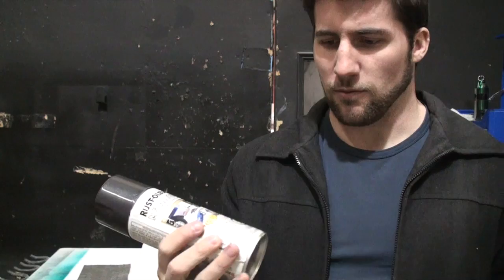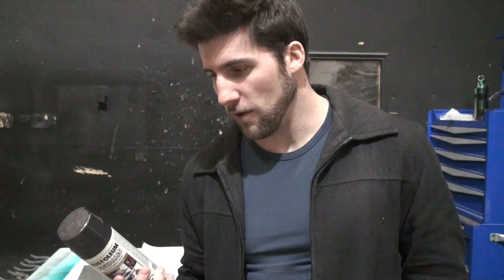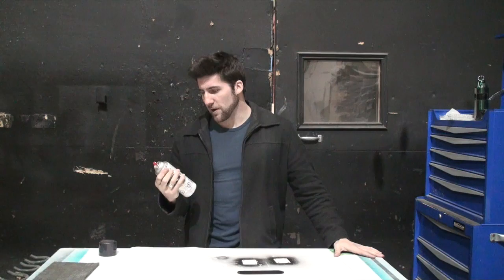What I'm going to be using for this particular piece is some pearlescent black from the Rust-Oleum metallic series — this one's called the Black Knight. Keep in mind that this product is not completely opaque, even after several coats. So I'm using it over a black base; if I were painting something white and wanted it to turn this color, I would put matte black underneath it first from the same company. However, since the piece is already black, that would be a waste.